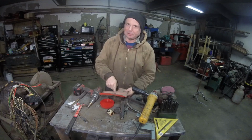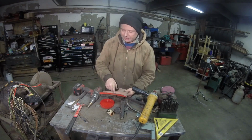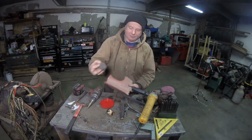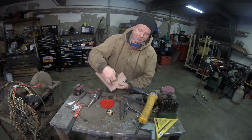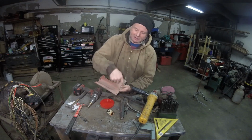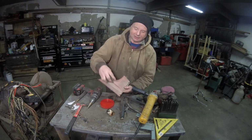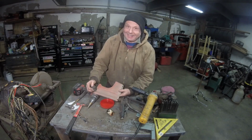Remember, we have to put the drain valve for the intake air box or air filter box. And right here is the one-way valve. If you put it right there, and you have this scallop, it actually looks like it's supposed to be there. So when I cut it around and I pound this down to make it flat, so this thing fits in and seals, when it drips down, it'll drip down like this, and it'll actually look like it's supposed to be there. I think it's kind of funny.